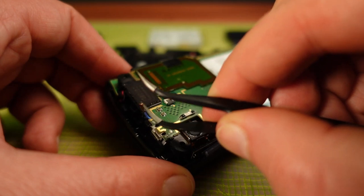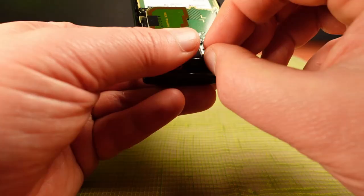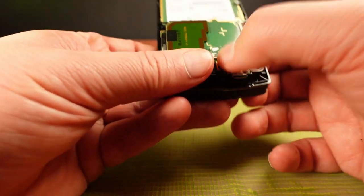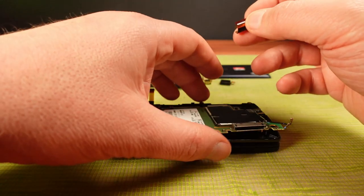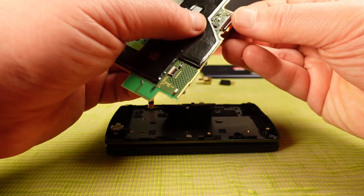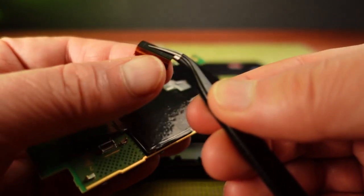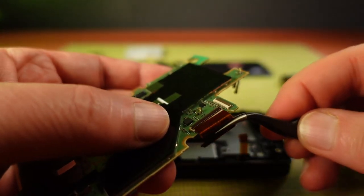There were also two moments during reassembly I remember being a little bit unsure. The two coax cables are colour-coded, and I couldn't exactly remember which one went where. And the tiny flat cable connecting the subboard to the mainboard, I wasn't sure which way around it went. I'd recorded the whole disassembly, and I really should have used that to put it back together instead of just guessing. I took the phone apart again, and sure enough, when I compared to the disassembly, this tiny flat cable was around the wrong way. I put it back together the correct way and reassembled the phone.